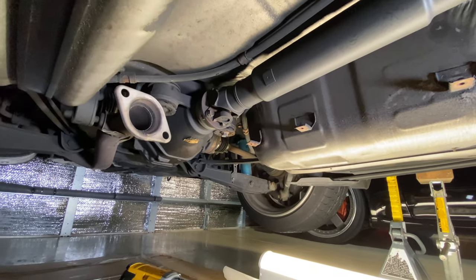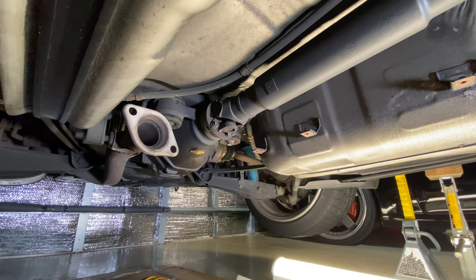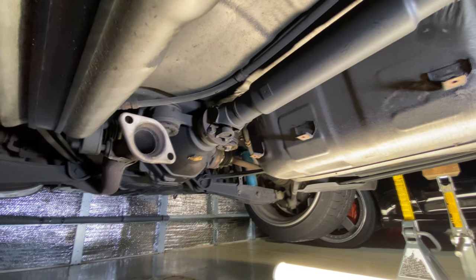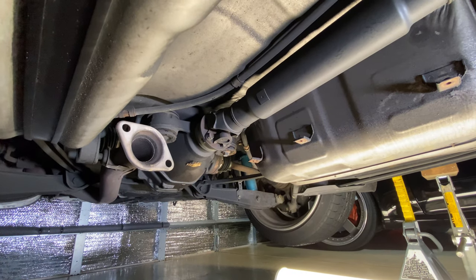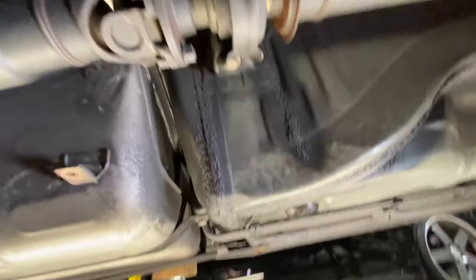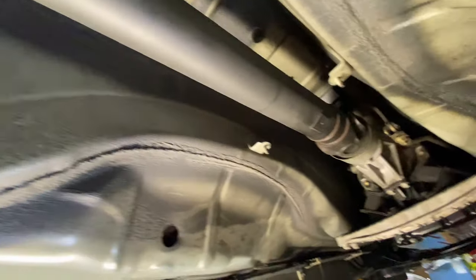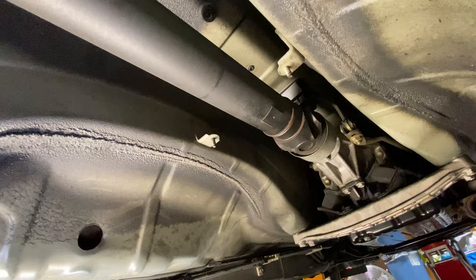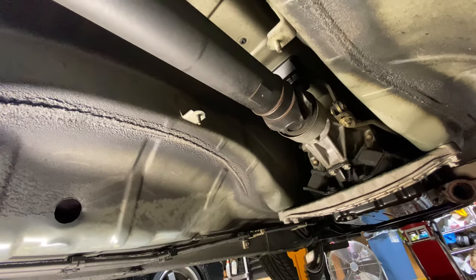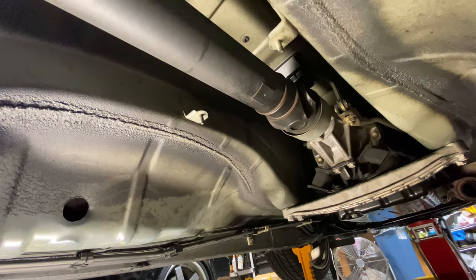To remove the drive shaft, you've got to loosen those 14mm bolts off the differential — there's four of them with a nut and bolt. You should be able to shoot them off with an impact. If you don't have one, you're going to need a wrench and maybe a swivel because it's hard to get a socket on either side. Once you unbolt those four, you also unbolt the two that hold the mid shaft. Then the drive axle just slips right out of the transmission. The transmission will probably leak some fluid when that happens, so be prepared to catch it and plug that hole with a towel or glove.